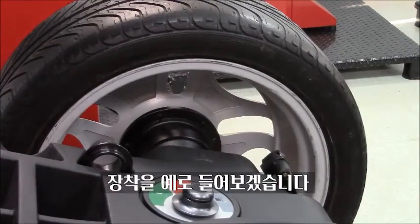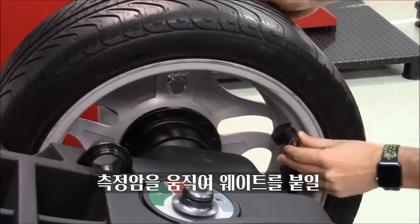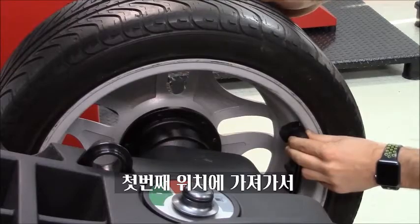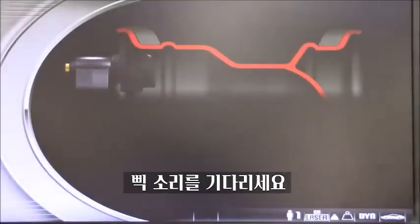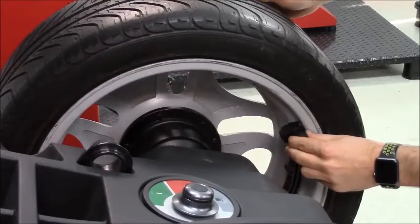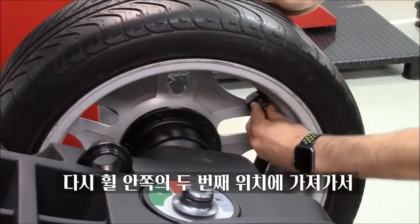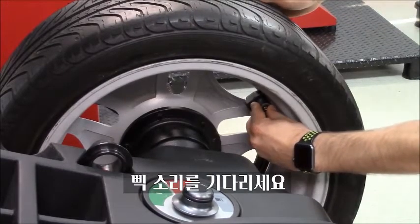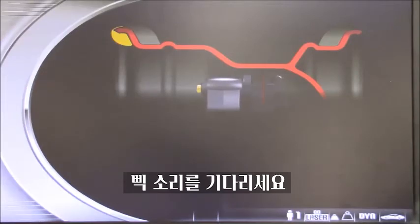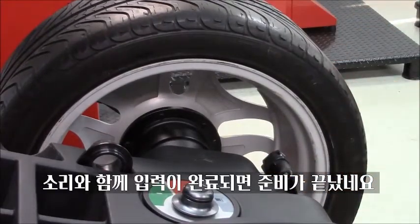Now we are going to see how to measure a wheel to use the aluminum program, so for tape-on weight. All I need to do with my measuring gauge is reach where I am going to apply the tape-on weight and wait for the beep. After that, we take the second measurement, which is on the inside of the wheel, and wait for the beep again. At this point the measurements are done — we just need to lower the hood and spin.